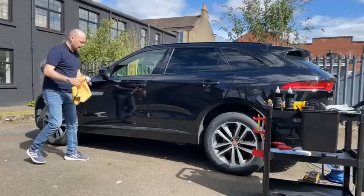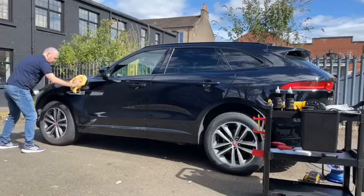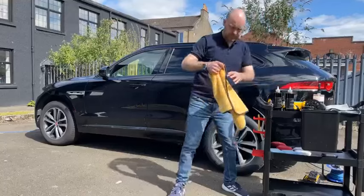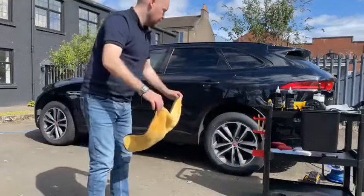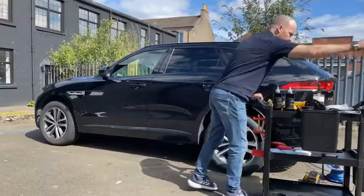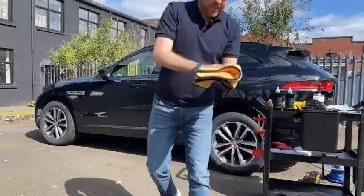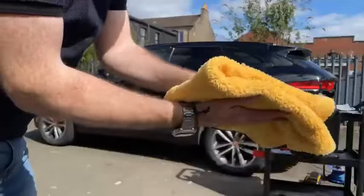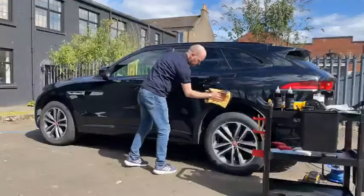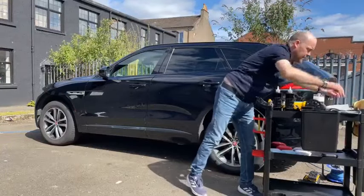There's a fair amount of pollen. The cloth I'm using is the Highlander — one of our more plush cloths, which I tend to use for quick detailing. I always use the more plush cloths because they offer more protection to the paint. They give you much more cushion between your hand and the surface. I always fold them over by four to maximize cushioning, then fold it out and let it air dry naturally.